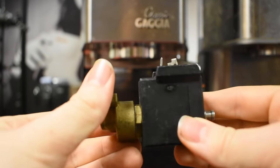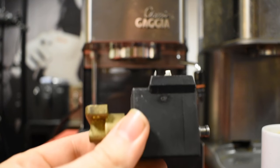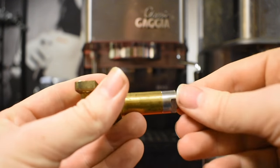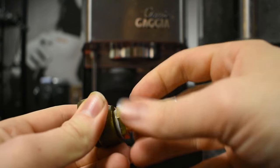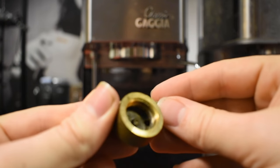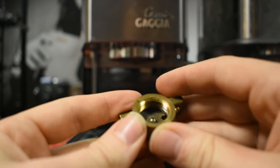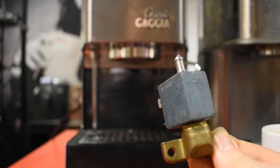If you have quite an old machine, you'll find that your solenoid valve is quite large like this one. If you have a newer one, then you'll find you have a smaller one. I'm going to use the bigger one because it shows up better on camera. This part here is a magnet — it's actually an electromagnet. What happens is that this activates and deactivates, which moves a little piece of metal inside this part here. As that little piece of metal moves backwards and forwards, the water is directed through one of these two holes. If you have a small piece of scale inside your boiler and it breaks off, it'll travel down through the valve and can potentially block up one of these two holes. In the smaller version, that's even more likely to happen because those holes are even smaller.